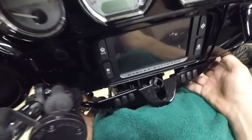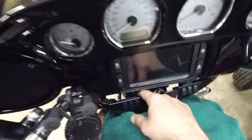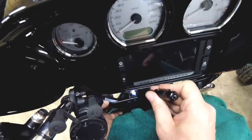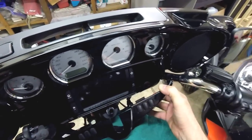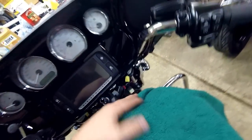You've got to get these tabs past the opening. These can be switches with accessories where they just have the coupler plugged in, so you need to unplug these couplers. Very carefully reach in there and unplug them — you can see the little release buttons. Lift up very carefully so you don't scratch anything.